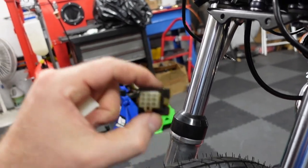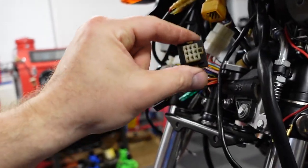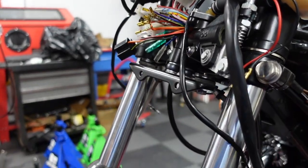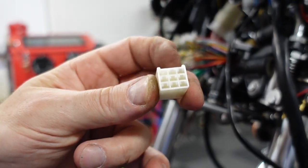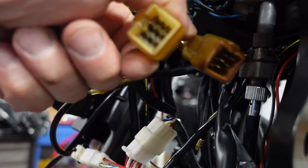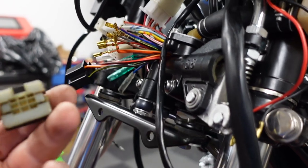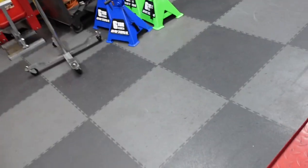And what was on the original harness was this. It is a similar kind of 9-pin connector, but not the same. The ones on the original harness match the ones on the cluster gauge, which makes sense. But the one on the replacement harness is this type, and you can see it has these little ears, and it doesn't have any provision for a locking tab. And so those ears are a non-starter. So I'm having to swap out two of those 18 pins altogether, and I have to get all of these pins in the correct place. So I think I have that one recorded properly.